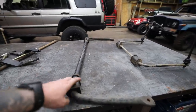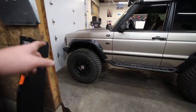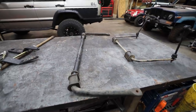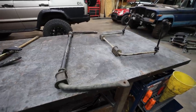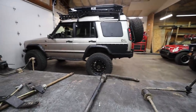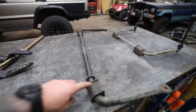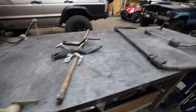I could do a really rigid sway bar like this — the factory sway bar from the front of the Discovery. I already put an anti-rock up front, which is much thinner, allowing much more wheel travel so you don't have to disconnect it off-road. It actually gives you more traction off-road. This front sway bar would be great for a rear highway application, but then we'd have to disconnect it off-road. And packaging is an issue because it just goes straight across and would hang down. So the next step up would be an anti-rock, but that's also a packaging problem — I can't put it in front of the axle because the links will hit it, and behind the axle it hangs too low.